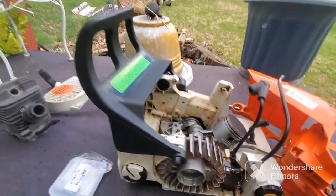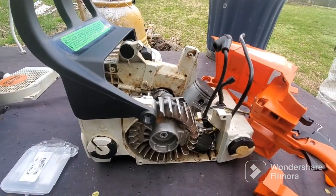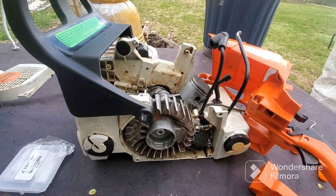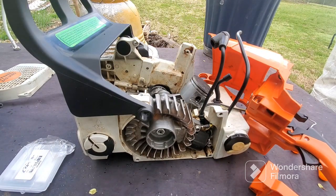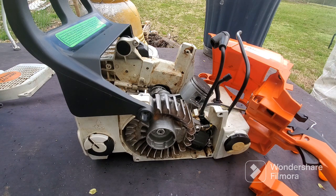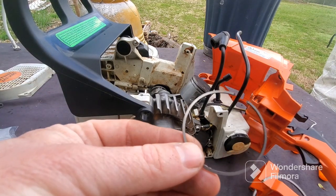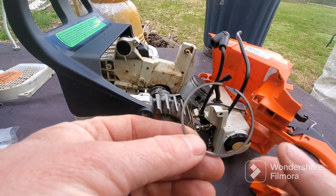The piston looks good — very good. When you pull the muffler and see that, you've got a very good chance that you're in the clear. I've already taken the rings off, and that was what the problem was. It was not the cylinder, was not the piston. This one does not have a decompression valve, so it was not that either — it was the rings. The dealer told them $500, said debris got in and the piston and cylinder were toast. As you can see, they're not.